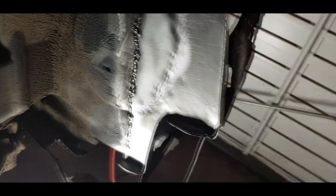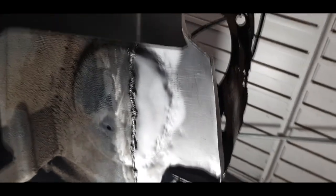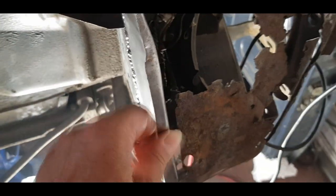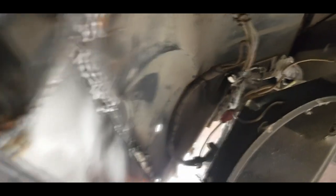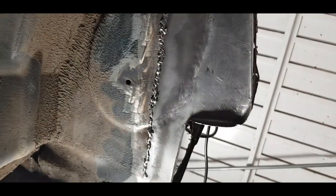I've got quite good penetration through there. I gave it a quick going-round on the bits I could get to. Like I said, I'm not overly fussed because this isn't a structural point of the car — it just ties everything in together. Once all the other bits are welded in across this edge it'll all be really rigid. I've heard that lap welds are one of the strongest welds, and I'm gonna seam seal the joint as well.